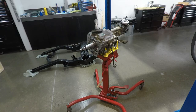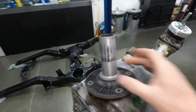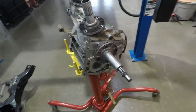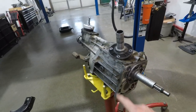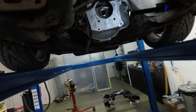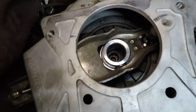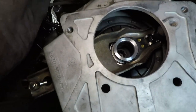Transmission is back together. I've got a new — well, new to me anyway — input shaft retainer. Here's a pretty good view of the one that came off: quite the gnarly mess. My good buddy Eric, who rebuilt the T5 in my green coupe, had one of these laying around and got it for me. It's all topped up with fluid and ready to go back in. Underneath the car we've got a new release bearing — this is a self-centering unit.